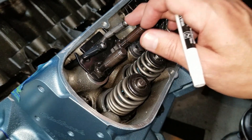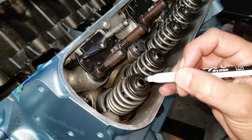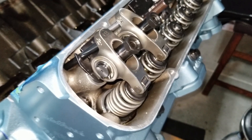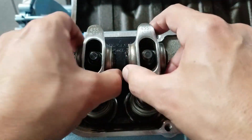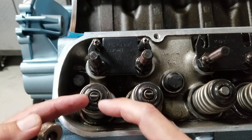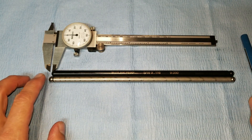I'm gonna do the same thing but with two different push rods — this one's about 150 thou longer. I didn't do the exact math yet; this is what I was using with my other lifters. We'll do our little experiment to see if we're gonna pick the longer rod. I turned the light off for less reflection. This line is slightly above center, and this line is perfectly on the center line, so I'm going with those push rods.